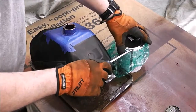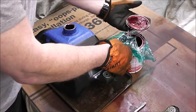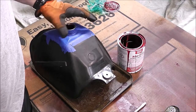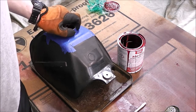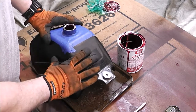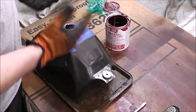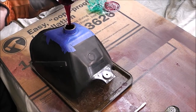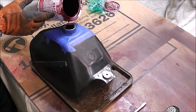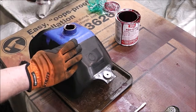This is the factory paint that's on there. Like I mentioned in last week's episode — if you didn't see that I'll put a link up above — these gas tanks are fairly expensive to buy. You can get a replacement in plastic and it would avoid doing everything I'm doing here because you never have to worry about the tank rusting out, but they're like $100. It's kind of nice to keep it original. I'm torn between doing something once because we know plastic is going to work perfectly, versus a $30 lining to keep it OEM stock where everything bolts up. I'm not going to put as much this time — that's why I lined it. I did that on purpose, just so I could feel like it did something.